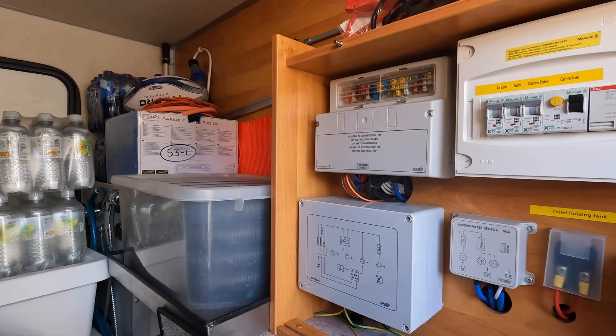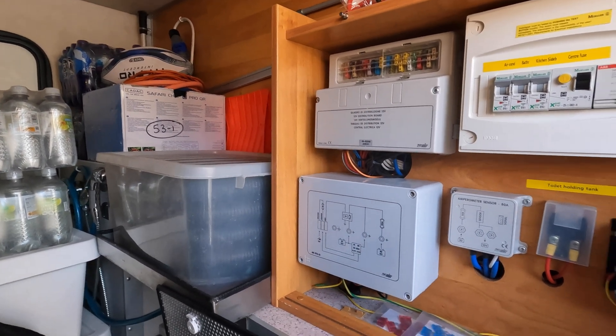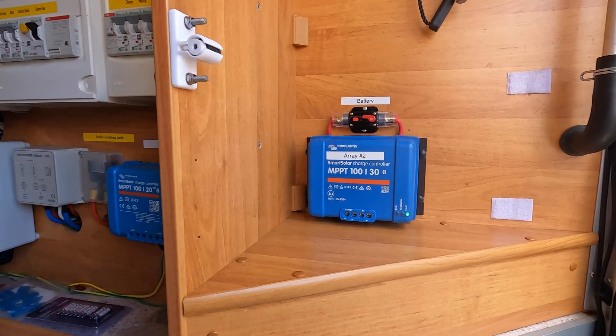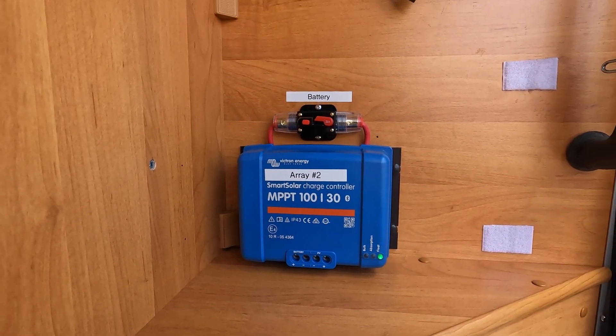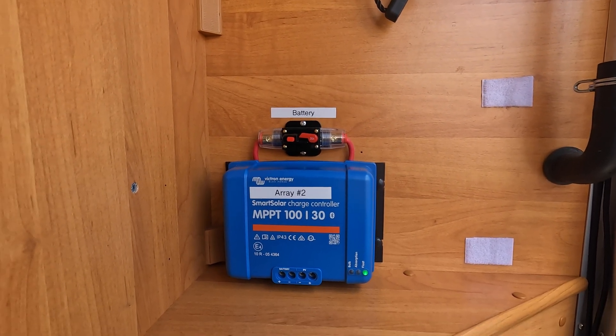After making good the wardrobe, all I've had to do is run a cable round underneath — through the gubbins in the boot, bit of a pain having to pull everything out. That cable runs straight round into the MPPT charger, and then from the MPPT into the battery via a 30 amp circuit breaker. The cable from the circuit breaker runs underneath the wardrobe, around behind all this, fed behind the main fuse boxes, and comes up to the new MPPT controller. Out from the MPPT controller via a 30 amp circuit breaker to the batteries.